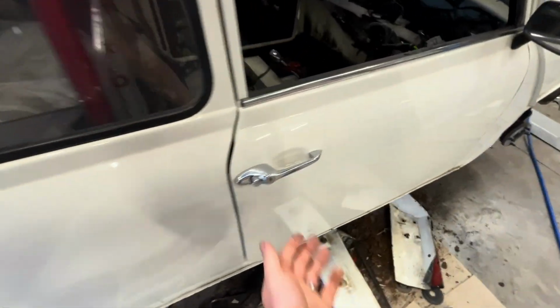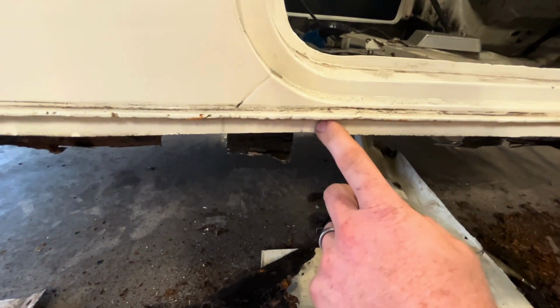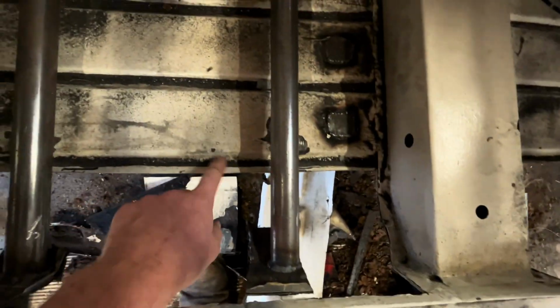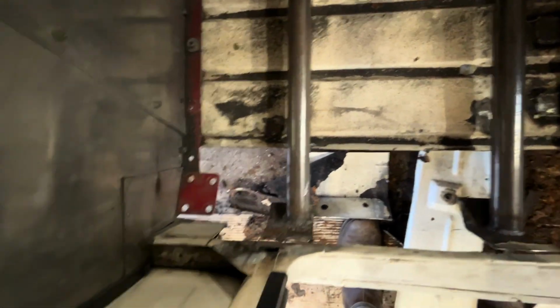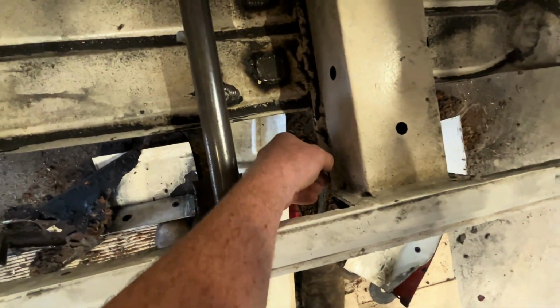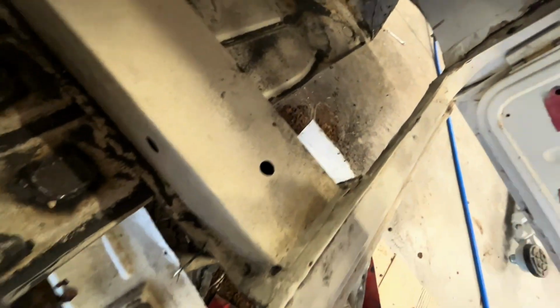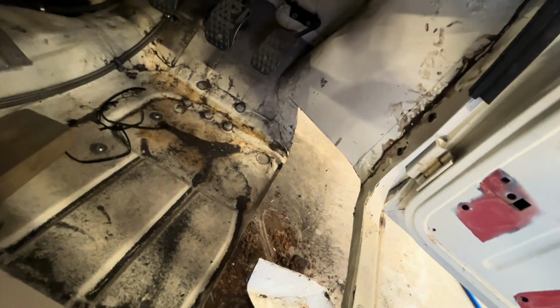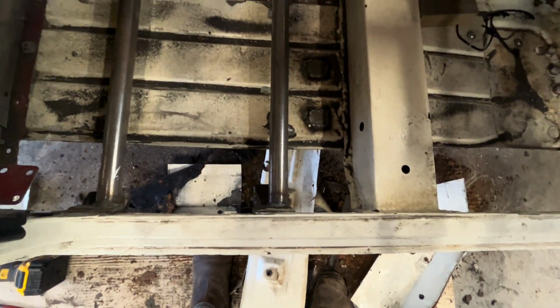So mainly all out now. What you tend to do is just cut it roughly where you want it. Obviously I've got that bit of the sill left, I've got this bit of the doorstep left, and then I've still got the first groove in the floor. So I will now tidy this all up. I need to grind that off. I need to separate all these layers from the cross member, get that separated, and then basically get it all clean, prepped, ready, and then I can offer in the new piece. So now all the fun bit starts.